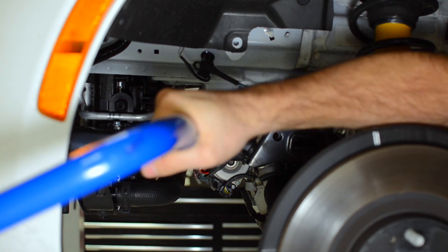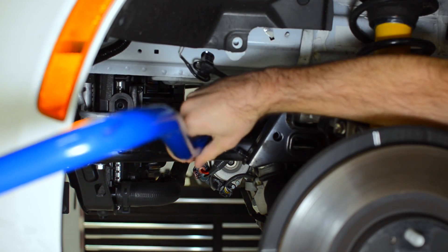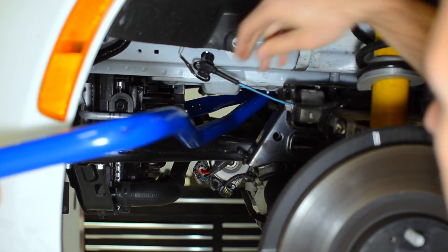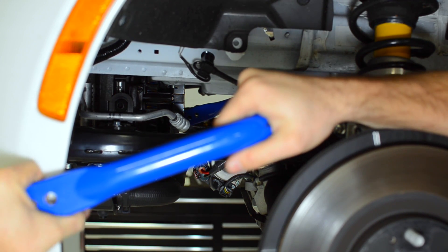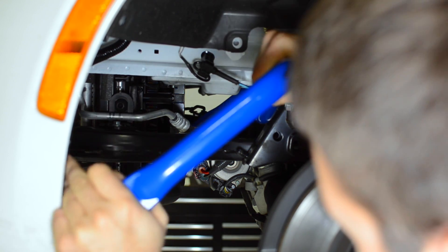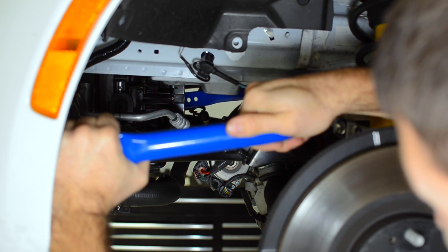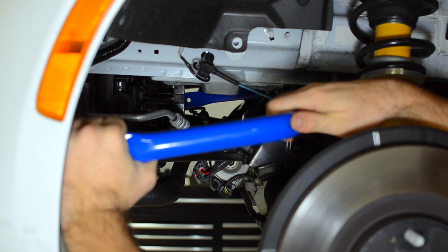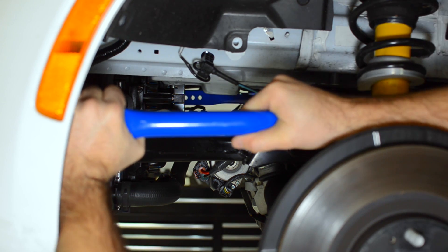Keep an eye on the right-hand side of the bar — you've got to go up and over the fan wires. Keep working it to the right. Watch the bumper and keep your hand over the end of the bar to make sure you don't scratch the paint. Continue pushing the bar into the chassis. Now we're at the point of hitting the coolant sensor, so be sure not to hit that and break it. Get the bar end up and over that and continue pushing it forward.